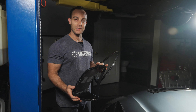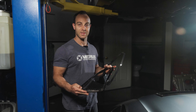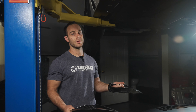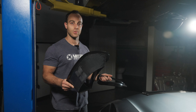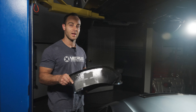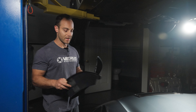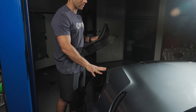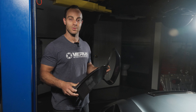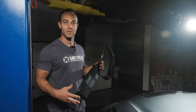We ended up going through quite a few iterations — we tried adding a lot of carbon and then milling it down, and we also tried adding a bottom mold and molding the two pieces together, which is ultimately what we ended up doing. People have been asking why these aren't released, and that's the reason: we had to go back at the manufacturing level and figure out how to make these fit better than they did initially. We're really happy with how they fit now. We'll be using double-sided tape to attach them to the hood, similar to our hood louver and various other products. This was a new development process for us and we're really happy with the results — the upper and lower skin makes the car look like a finished unit.